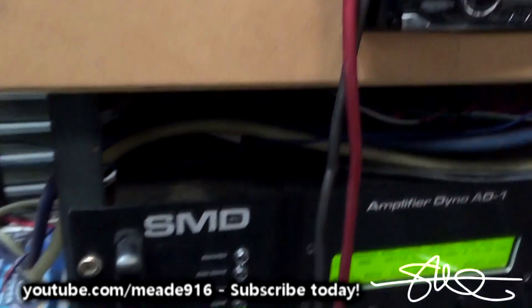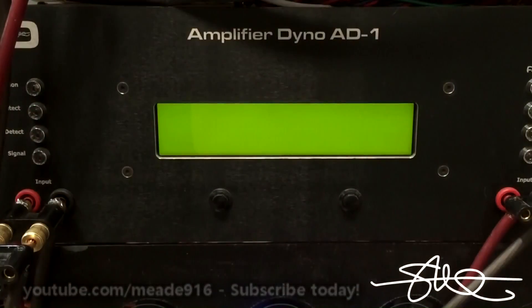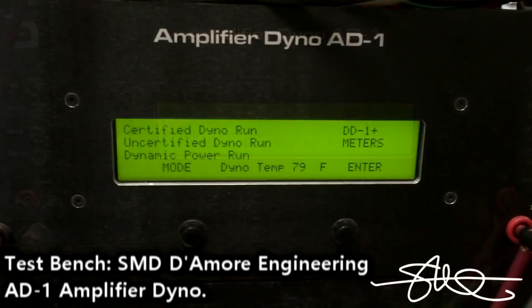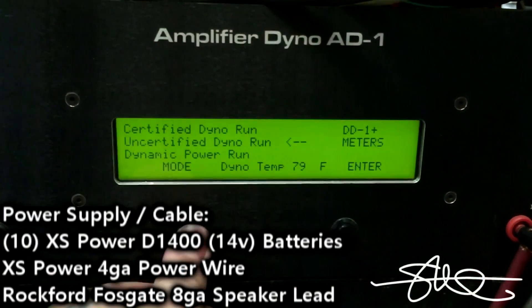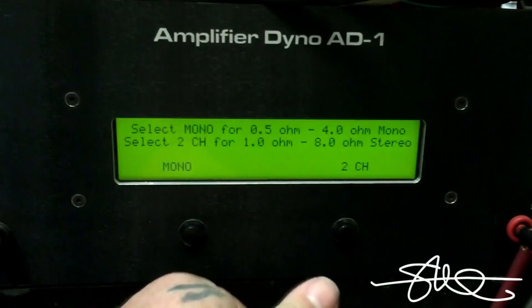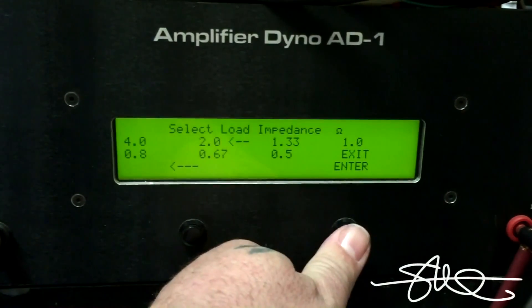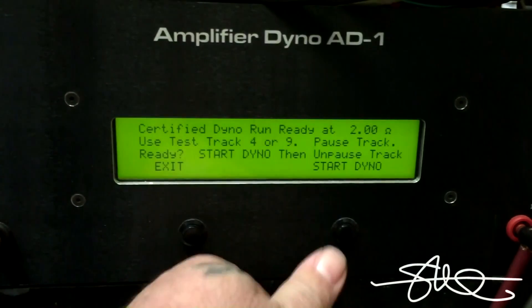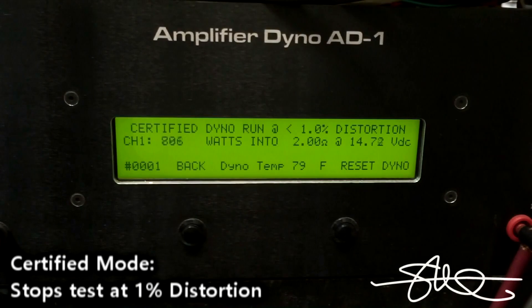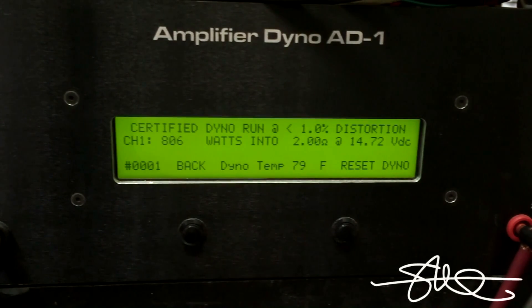As you can see, the Rockford amp is wired straight into the 81 right here. No terminal. Alright, straight wire, no terminals — two of each. Two ohms. That's putting one ohm across each channel since I am bridging.